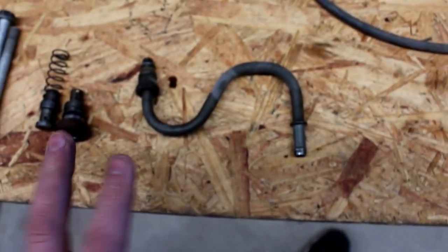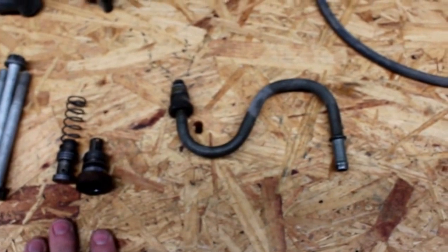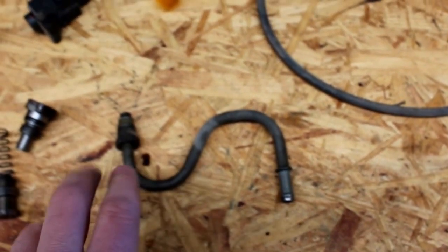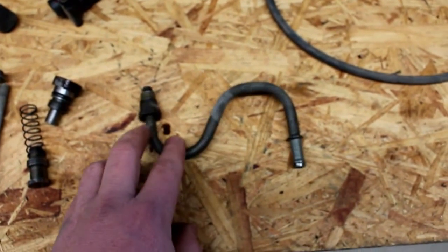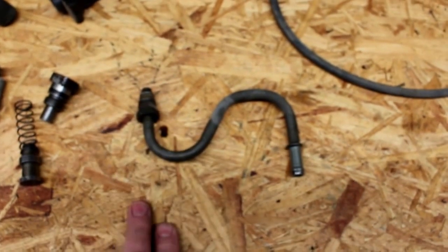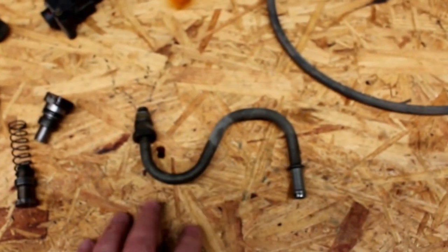The other big thing that I got at the junkyard yesterday was information. So power steering hose. I've been trying to figure out what power steering hose I want to use, because I got a truck motor, Chevelle chassis, and so on. So I searched around, I took some photos of the car, took them with me, and started looking around, and I found that an 86 Cutlass has the exact power steering high pressure hose that I want. So I'm going to order one of those from the auto parts store this week. The one that was in the car was crusty and rusty, and I don't want to use that. But at least I got information on it.